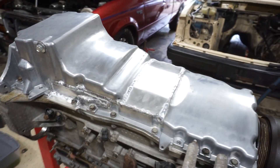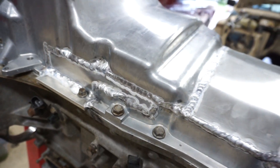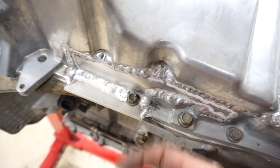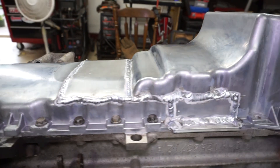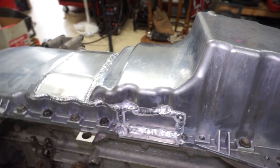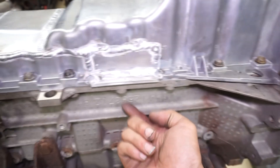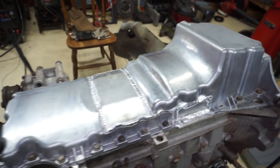Just like that we have an oil pan. The gaps filled pretty well — no issues there. That was a big gap there but they all filled in really nice. I didn't lay a bead behind where this bolt is — I'll catch that one from the inside. Turned out okay. I think that should work. I'll just have to leak check it, probably do some welding on the inside. I also have two more bolt holes I can work with. I might end up making this one here, but other than that I think this thing turned out pretty good.